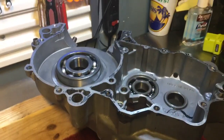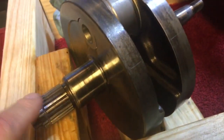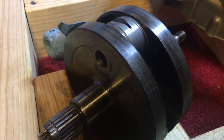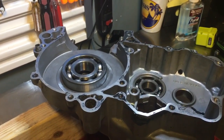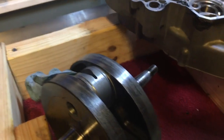On mine, he'll actually need to build up material on the journal - I believe through weld - and then regrind it to spec. I have that problem on the left side case but not the other side; the other side is very tight and I had to heat the case and drive the old bearing out so Tom can do measurements. You send it off to Tom Morgan Racing. Mike Weir at KX Guru Racing is another guy very familiar with this, but he'll probably also direct you to Tom.